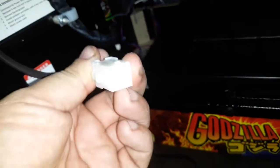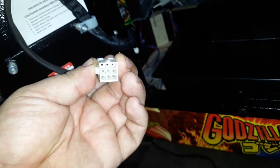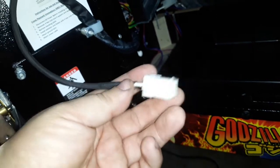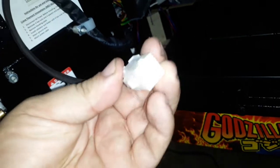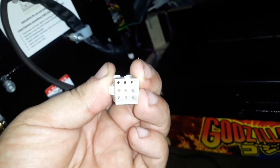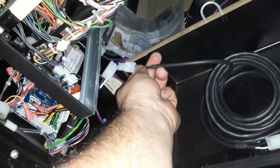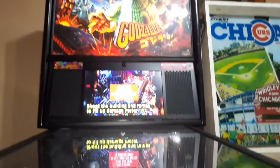Here is your connection for your bill acceptor. It's got the 9-pin connections there, female. You can use a 12 volt bill acceptor, but most of us have 110 volt bill acceptors. So what we have to do is run this cable from right here all the way through to the head of the game up top.